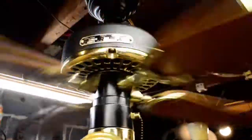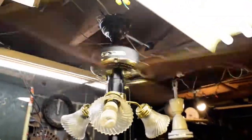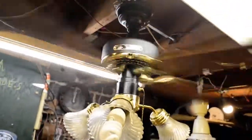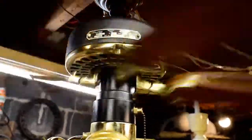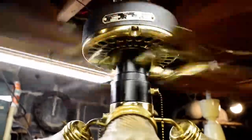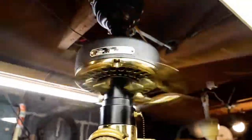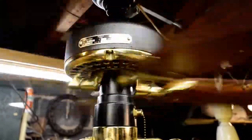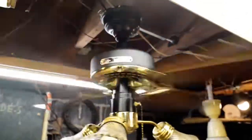Let's go to high. It has a bit of a startup hum and a running hum as well. Because it has the adaptair irons, which are about as light as the normal irons, it flies on high — unlike the reverse irons which, because of their weight, add extra drag to the motor and reduce overall speed. That's why I'm not a fan of the smaller reverse irons, but these are cool. It should do about 340 to 350 RPM on high.